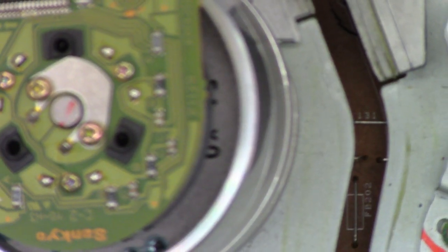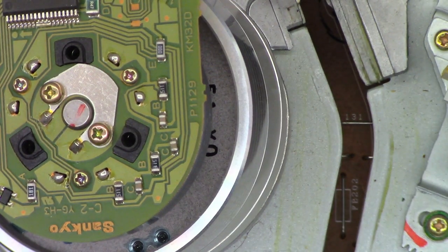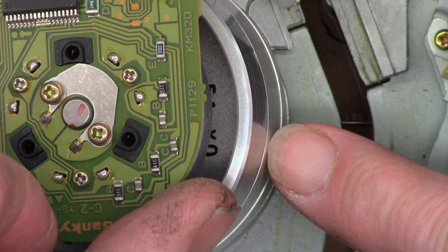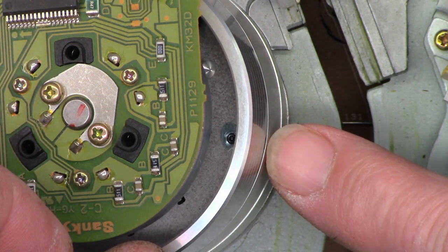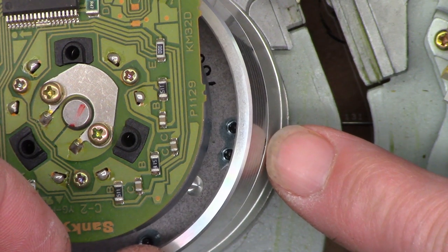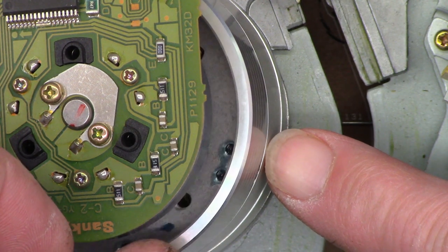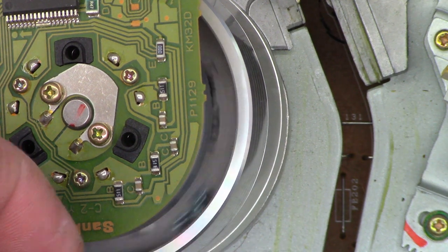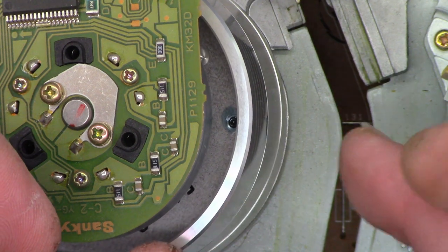And that's the tipping point right there. We'll bring it back just a little bit and let it refocus, hopefully. Okay, so down here at this little gap right there, as I run the heads around, you should actually see a bit of protrusion. That's one of the hi-fi heads right there. Then those are the two video heads and another hi-fi head right there. And then the other two video heads. And yeah, they actually have a bit of protrusion left.